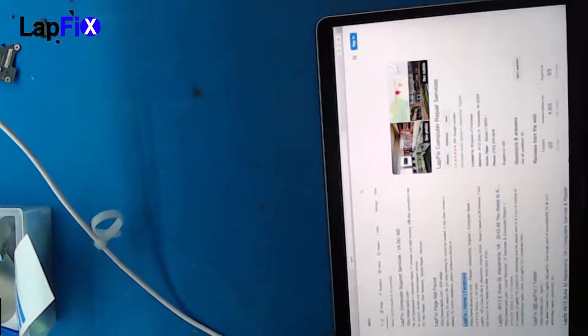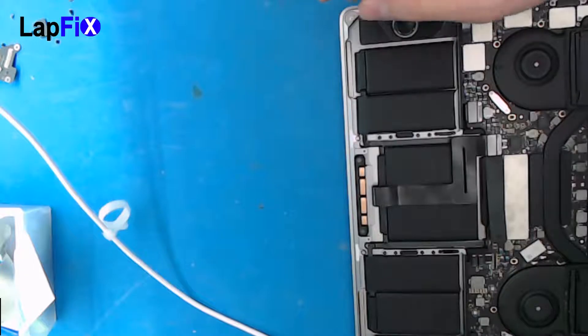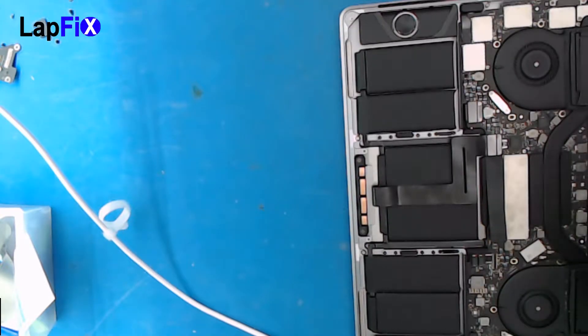So it's pretty simple and straightforward. Again, there are two cables you want to be careful of — of course, the power cable and the trackpad cable. I would recommend buying one that does have a cable with it. Definitely do that because it's just in case — it is glued at the bottom, and if you get a little bit of a tear, you could rip it. So make sure you do that. Anyways guys, that's it — thanks for watching. We can put on the lid for you, but you know how fun that is and we don't really want to get into that one again.